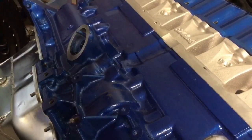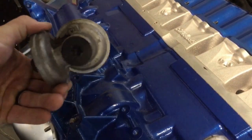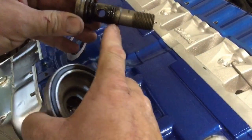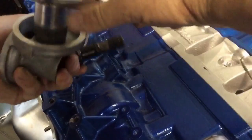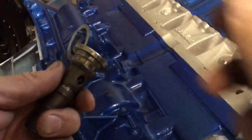Now I'm going to bolt on the oil filter adapter — just going to disassemble this and put some new seals in it and clean it up. Then I've got an oil cooler to go on with it. You've got two seals on here. This is a one-inch fitting — just break it loose and spin that sucker out. The oil can get pretty varnished in there, so you want to make sure to scrub all the little bits and pieces out so your new seals fit perfectly.